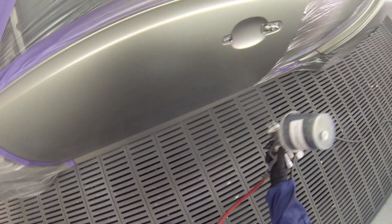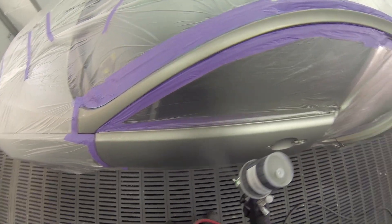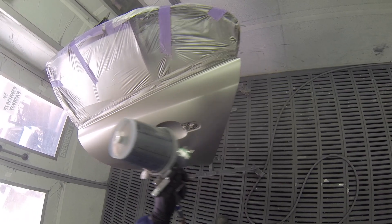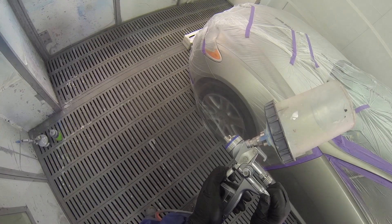Here's the technique coat — or drop coat. We're only at one and a quarter turns out on the fluid tip and down at about 1.1 bar, just laying it on nice and even. Just wet enough that it's not dry spray, but we pretty much want it to dry instantly. If you put it on too heavy you've got a chance of mottling up or putting too much color coverage where you don't want it. Also, if you're the tiniest bit see-through, this drop coat with the PPG Enviro Base will actually give you that slight bit of extra coverage.